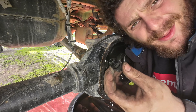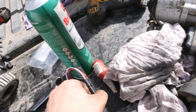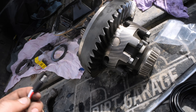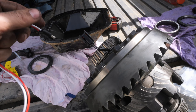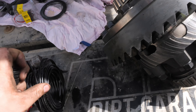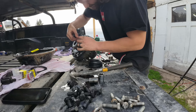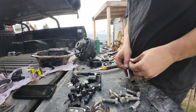This fitting just threads in and it's got its own seal, so it should be good to send it in just like that. The plan for the electrical inside the diff is quite simple — I'm going to use a simple two-wire plug: take this plug off, solder in this plug, and coming in from the differential side will be a wire poking through. It's a simple two-wire setup that will work inside these plugs. Gears moved over, electrical all ready to go — time to slap this sucker in the diff.